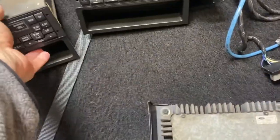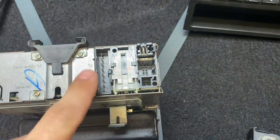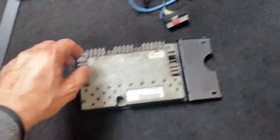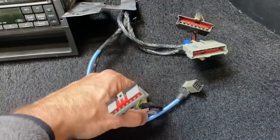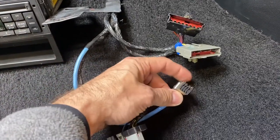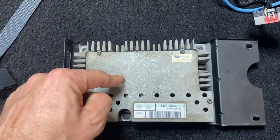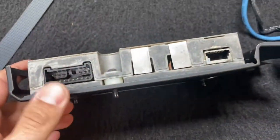These radios are different. On the reverse side, they feature a slightly different hookup. You've got your power connections here, but your speakers actually run through this connector here, which goes to the amplifier. As a result, the harness that connects to the back of the radio is different. These are your connections that go into the body harness, and these two connections go into the back of the head unit — main power wires here and speaker wires here. The amplifier is also different from the football amp typically located in the center console. This amp is located under the passenger seat and has very unique connections at two points on the amplifier.